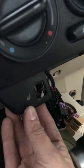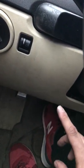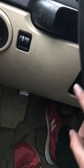There's also a screw back here you need to unscrew — there's a little cover you pop out and unscrew to loosen the whole panel, which folds under. Behind the heated seat cover pops out and gives you access to screws, and then a big metal plate that goes all the way across — all Allen screws — which you need to remove.